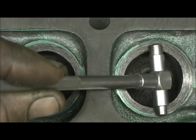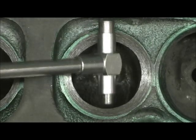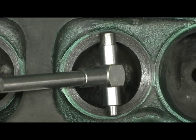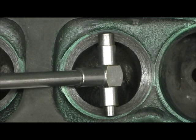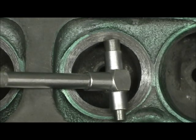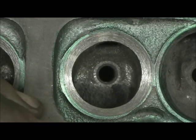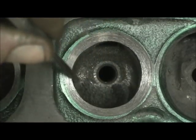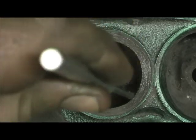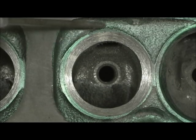I'm going to focus on one particular hole right now so you get a better view of it. As you can see, the 1.60 almost touches the green; it totally takes away the 60-degree silver. Now it doesn't take much to look and say: wait a minute, look at this hole — not the silver part; this is the part where the valve sits. What about this circular area right here? That's right — this area here is actually the hole diameter that the big 1.60 valve tip goes to.